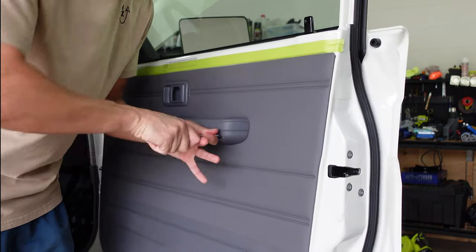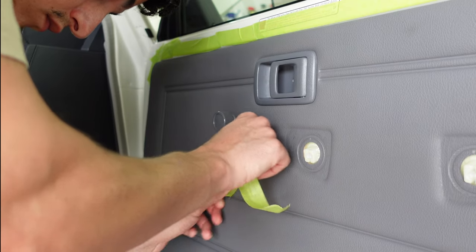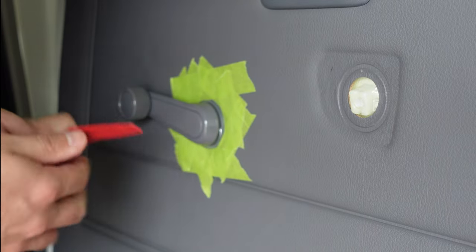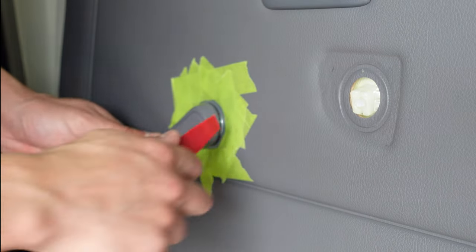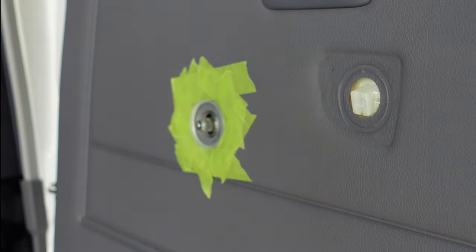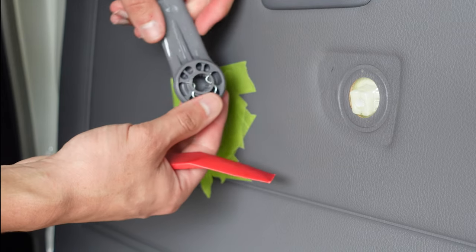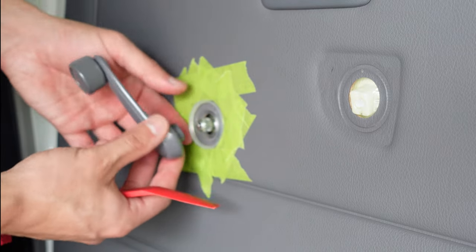To remove the door cards, I unscrewed the armrest with a Phillips head screwdriver before taping around the manual window crank. These door cards are easily damaged so care must be taken. Using the thinnest pry tool I have, I pushed the plastic collar down to see where the end of the retaining clip was, then pushed the open-ended side of the clip towards the closed end. You can see how the retaining clip just pops out. I also pushed the retaining clip back into the crank after removing it, as putting the crank back on is easy — it just needs to be pushed on. I had troubles figuring this system out at first, but the main idea is to unseat the clip so it no longer catches on the grooves of the manual winding male connector. Hopefully this footage gives you an idea of how the clip is held in so you can remove yours quickly.